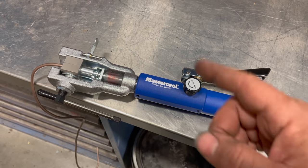I have the new line installed — now I just need to add brake fluid, bleed it, and see if I have any more leaks. I started bleeding the brakes and heard some air popping up over here, so I need to tighten up these connections at the T-connector. Brakes are bled and the fluid is topped off — feels like the brakes work. There's one last thing I want to do right now and that's fill the radiator with water to see if the system leaks. I have the radiator full of water; it doesn't seem to be leaking from anywhere, so I think the system is good enough for now.